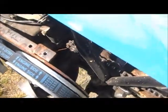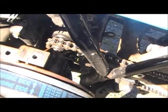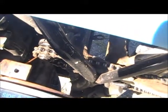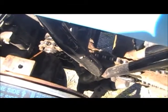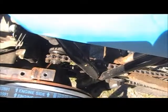And I also put a double roller sealed bearing on the end right behind the sprocket there, and it is welded to a bracket that bolts to the frame to keep the jack shaft from flexing. If you don't do that, even with the stock plate, I'm sure that's why it broke the stock plate. When you run it, if you look down at it, you'll see that it flexes when you give it the gas. But that bearing on the other end of the jack shaft, I'm hoping that's coming in okay.